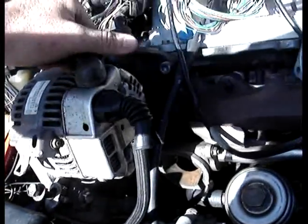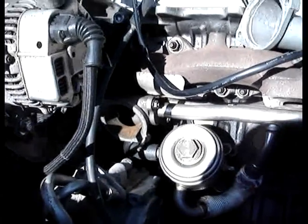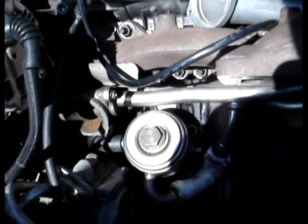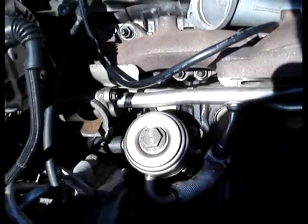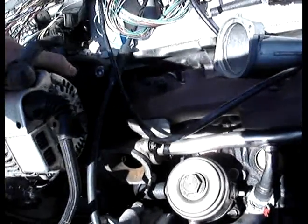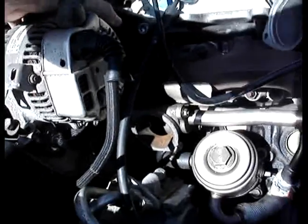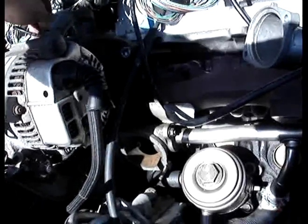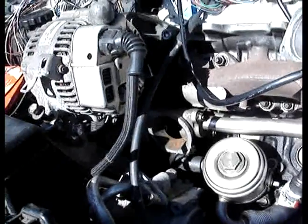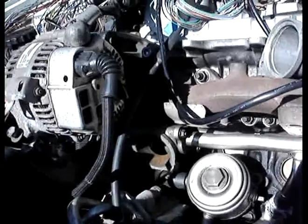The hardest thing to find was the alternator bracket. The MR2 alternator bracket is actually mounted where the power steering pump is on this engine. The 2.2 liter in the Celica and the 2.0 turbo 3rd gen 3S-GTE both use this type of alternator bracket but it mounts into the head. The 2.2 has a different head so I had to get one from the GT4 — which is almost impossible to find. It has to be from the 94 to 99 GT4s that only went to right-hand drive countries.